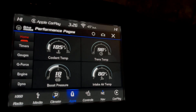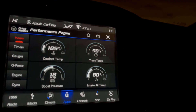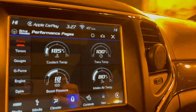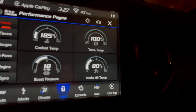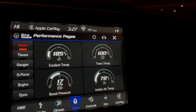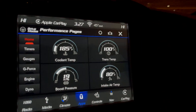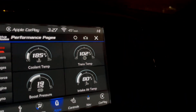That's weird. But remember for this test, a couple degrees of IAT — we should have a little bit of wiggle room. It's still at 80 — it should drop though. 37 miles per hour — here we go, got a little bit of movement. 78 to 80, it doesn't know what it wants to do. 37 miles per hour and we're still at 80 — it went up. 36 miles per hour, 78 — we're almost back down to 77. 37 miles per hour, IATs are still at 80.